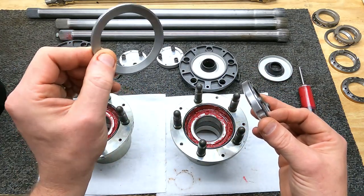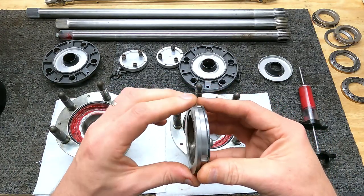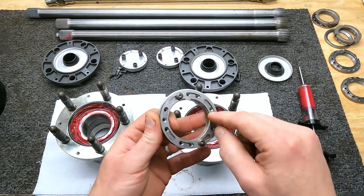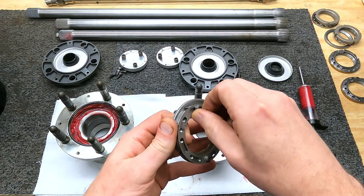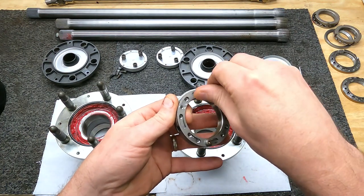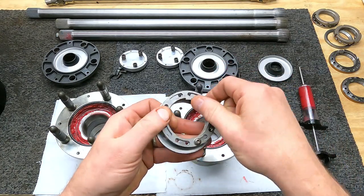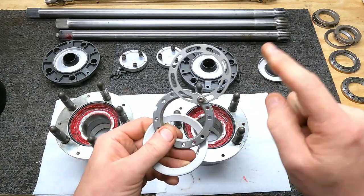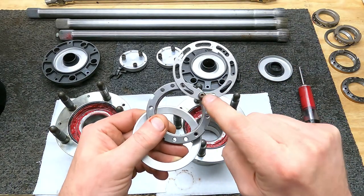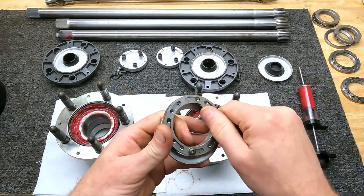They use a spacer. This spacer is conical to fit the nut, and this will actually move a little with the wheel bearing. It has a locking tab on the outside that's held in place with twin 1032 screws. Once this is screwed down and locked into place on your axle tube, this actual flange bolts to the nut. It has a tab to lock it on the tube, and you torque down these 1032s, and this can't back off.